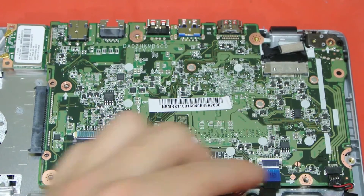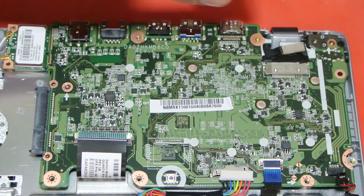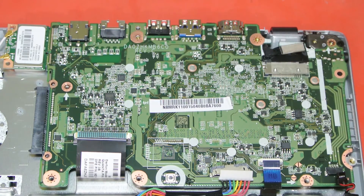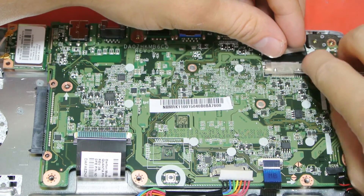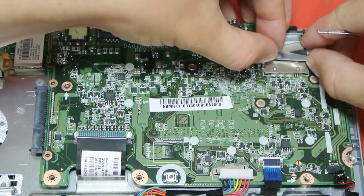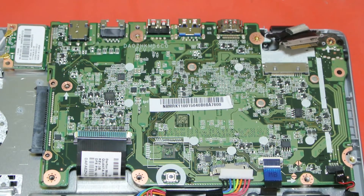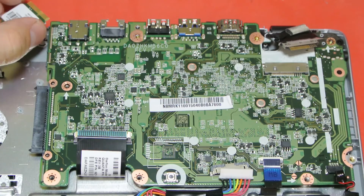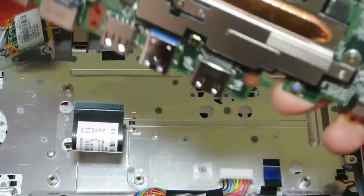The speaker connector is very stiff, so just take your time. Once that's slid out, be nice and careful with everything. Next is the monitor cable — there's a bit of tape here over the screen connector, so just flip that up, untape it, and remove it. Also make sure you disconnect the Wi-Fi before lifting the board out.